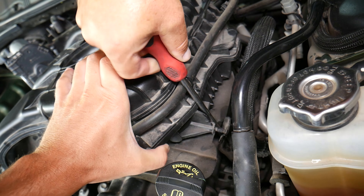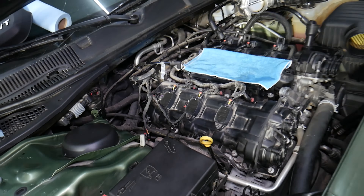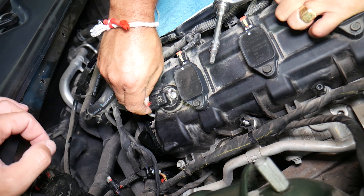Let me show you something quick. These gaskets need to be replaced every time you remove it. We'll put a link where you can get the intake manifold gasket for the 3.6 engine. Otherwise you can develop a vacuum leak, have unstable vehicle operation, rough idle, vacuum leak codes, lean fuel mixture codes — something that will be super hard to fix. Be very careful not to drop anything in the lower intake manifold. If you do, it will make its way to the valves, you can bend a valve, it can get in the cylinder, and it can destroy piston, engine block, or cylinder head.